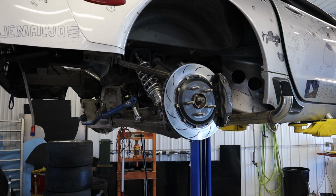But the front end, there's not a lot you can do other than trail brake, which we did. I was trail braking almost constantly into every corner at Coda, just trying to make sure the front end was there, and if I didn't, it would wash out and push. And when I did trail brake, the other cars were just carrying a lot more speed through the apex, and so that's something I want to fix. And so I'm hoping what I'm doing now is a good start, and I think I probably went too far, but we can dial back.